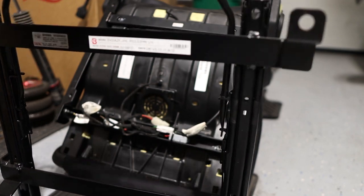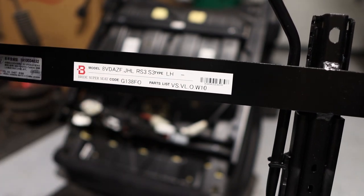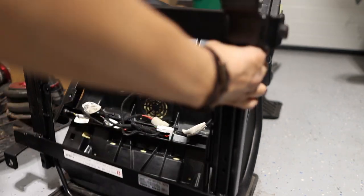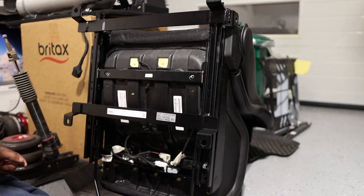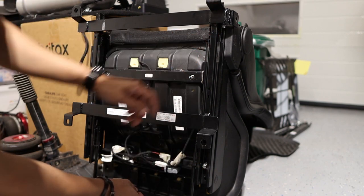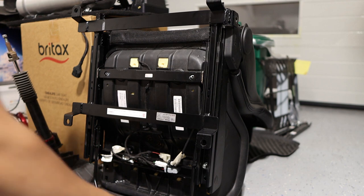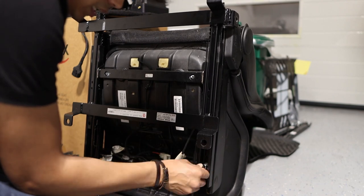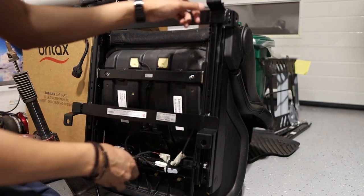Grab your seat rails and sliders — I have the Bride ones. It says 'left hand' on this side, which is the driver's side. The adjustment handle points down with the seat, and the belt buckle should be on the right side since we're in North America. Secure the bolts onto the seat rails and we should be good to throw it into the car. Some people use blue Loctite, others don't — I don't think it's really necessary unless they're backing out. Use the correct Allen head when tightening, and pull the lever to move the rail downward if you need to access the back holes.